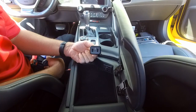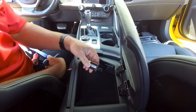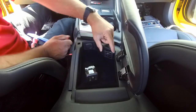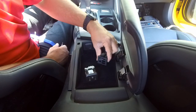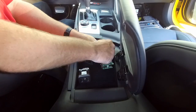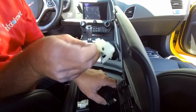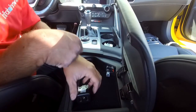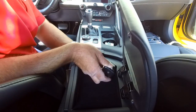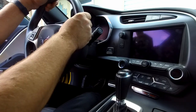The last step is replacing the media hub with the one included in our kit. On both sides are these little tabs which hold it in place — once you free the left side you can wiggle it out on the right, or it'll just pop right out. Pull it out, disconnect the connectors in the back, set the old hub aside — you'll no longer need it. Then plug the exact same connectors into the replacement media hub.